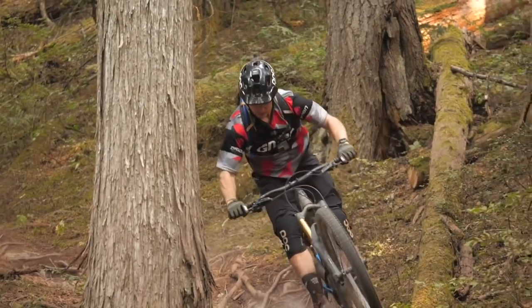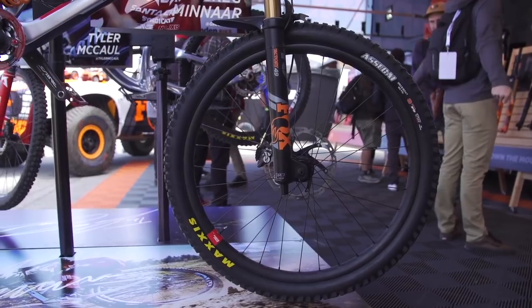It's about modulation and balancing out that power, and that's what they do really well on those bikes. I just don't think it's necessarily needed on mountain bikes yet. We've got huge disc rotors and I don't think there's going to be a huge advantage to it. You certainly don't need more braking power, though perhaps it could help manage heat better by spreading the load across the pads. I think it's unnecessary weight for now. It has been done before and they look very cool, but there were problems with leakages and at the end of the day it just wasn't really needed.